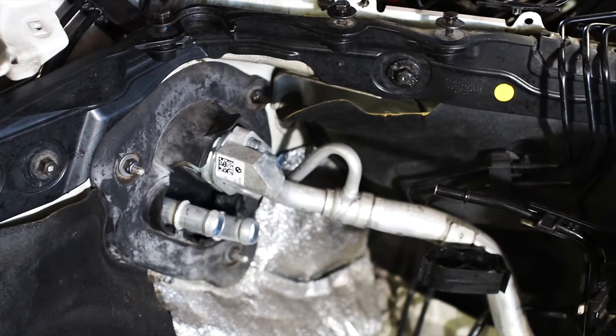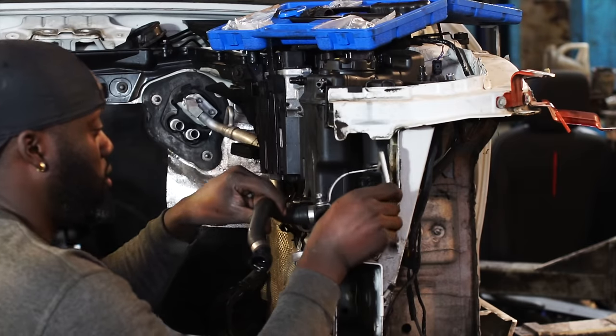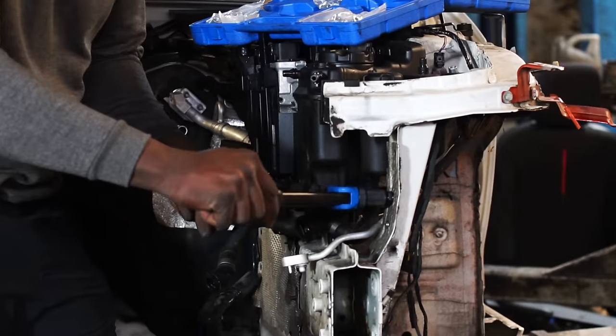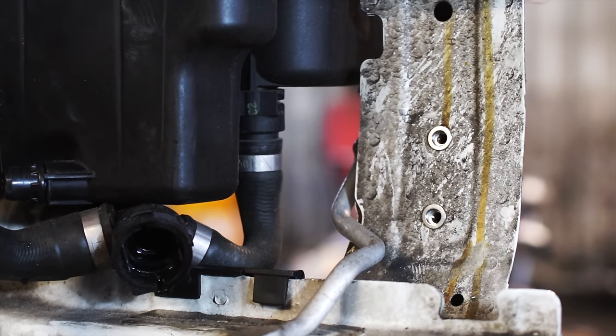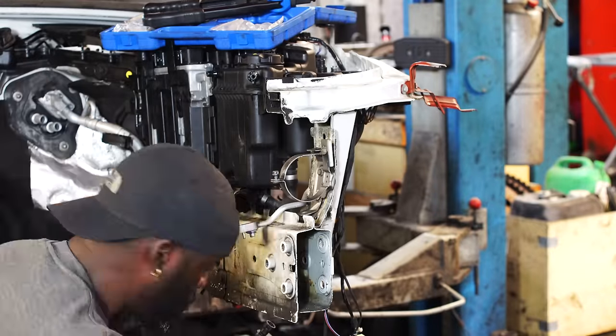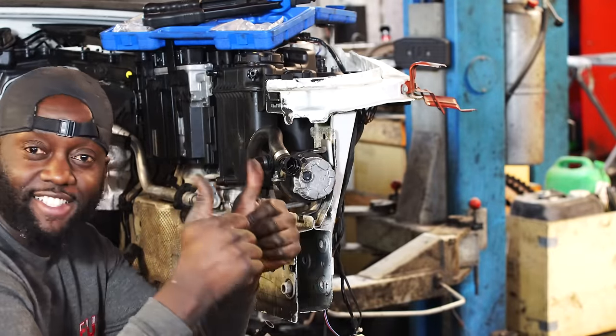With the ancillaries fitted, I'm moving on to the next important step in the engine bay. Now on the M140, this is where you'd find the auxiliary water pump. However, the 114i does not run that water pump, but the chassis has actually got two vacant holes. Like I said, they're the same chassis. I fitted two rivnuts, and there's me fitting the bracket and the water pump, and there you have it. Water pump in place as it would normally be on a 140.